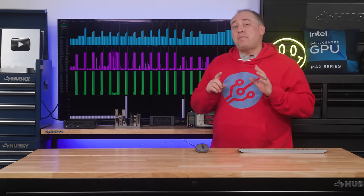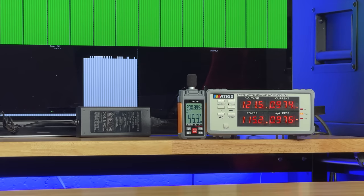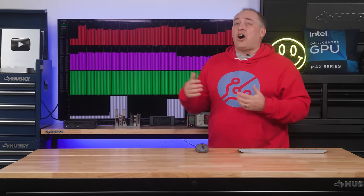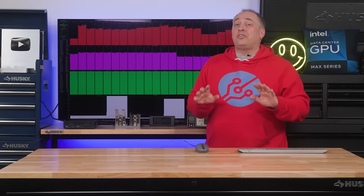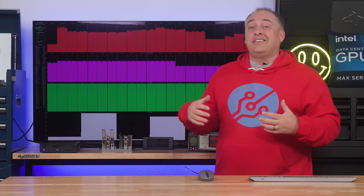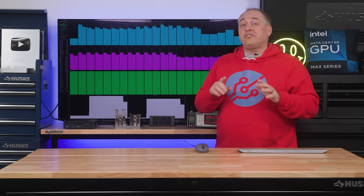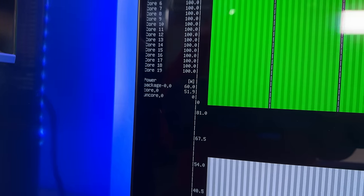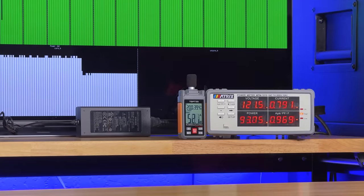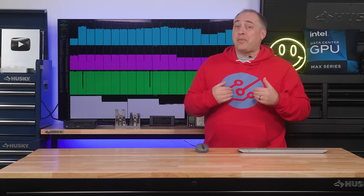Turning on stress-ng, the package power consumption goes from 10 watts up to 80 watts, and at the wall our power consumption goes up to about 115 watts. The fan starts to spin up, eventually reaching maybe 42 to 45 dBA — definitely audible at 100% CPU utilization. Then the temperatures hit the red range as the fan ramps up, but in around 45-50 seconds the package power drops from 80 watts down to 60 watts and wall power drops from 115 watts down to about 95 watts. You get a nice burst of speed, then it dials the settings back to keep thermals under control.